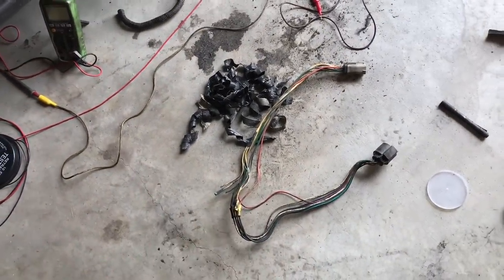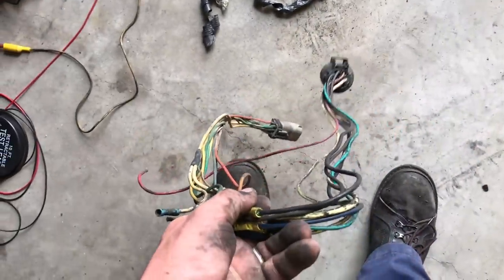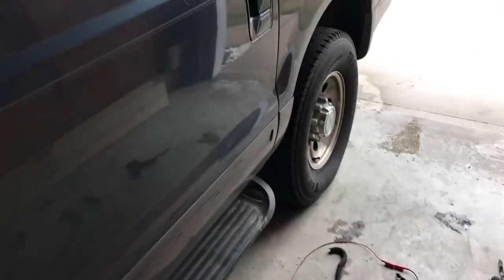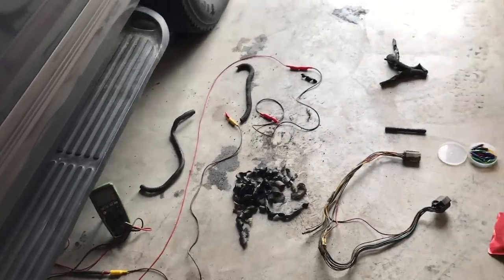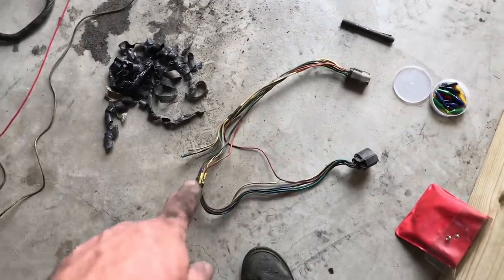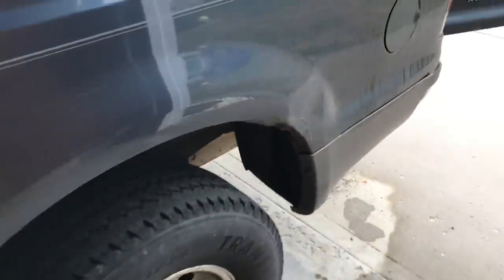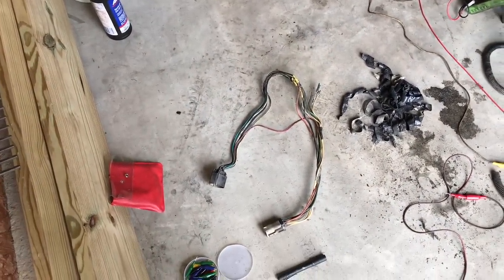I didn't even have to test the circuits from the middle of the truck to the back, because when I pulled this wire harness out I found the problem. I did some research on the forums and found some unanswered questions from people who had the same problem. It took me a while to find this because I was chasing circuits, and all this is wrapped in wire loom and electrical tape — you can't just shine a flashlight up there and find it. You have to actually start taking wires out. It's tucked behind the rear bumper, behind the license plate, and up along the frame. Fortunately, that small section of wire harness is where our problem was.